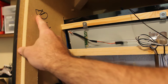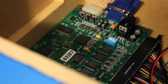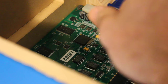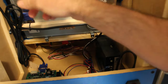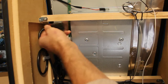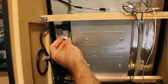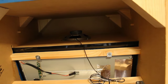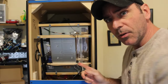Looking here, it says what looks like 'AD' as initials, dated 9/17/21. The board says '60 in 1,' which makes sense because there were 10 screens and 6 games on each screen, so there are 60 games on here. It definitely just has a VGA output, which is awesome. On the other side, there's a power supply, and a wire goes up and powers the screen — it looks like a regular three-prong PC cable, which also powers the whole device. Here's the speaker, and there are two wires — the black one's connected, and there's another one just hanging there. That's why there's no sound — this just got unplugged at some point. I'm going to plug that wire back in; it just clamps back onto the speaker.